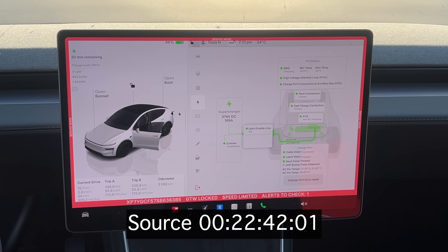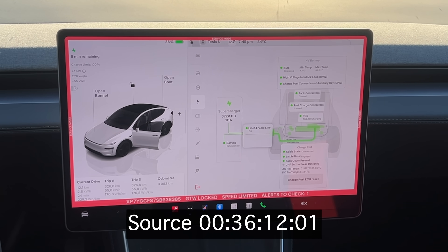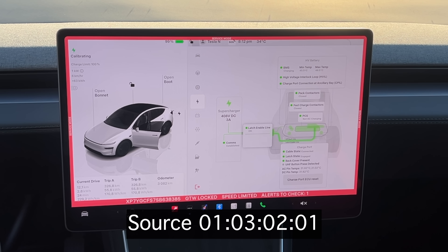It's still doing better than the old CATL pack, but above 60% the CATL LFP packs are not charging great. Now it's just a slow burn until 100%. To think this battery is actually charging better than the LG battery is absolutely insane. At 88% we're doing 40 kilowatts; at 94% around 30 kilowatts. We reached 99% at around 50 minutes of charging, followed by top pack calibration. At one hour and four minutes the top pack calibration was finished.